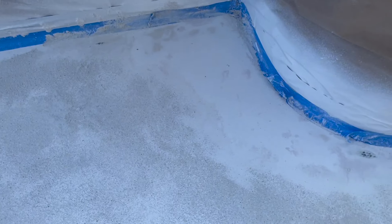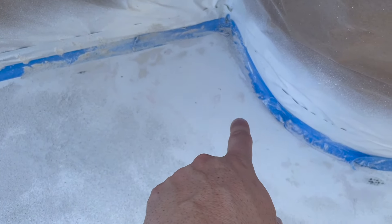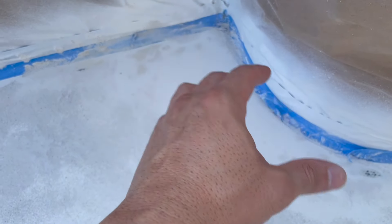I'm going to show you that in a second. Basically what I had to do, or what I tried to do to fix it at the moment, was dab some new gel coat on the areas that didn't have non-skid on them. That ended up being a mess because I picked up sand from all over the place, and it made just a mess of the deck in some spots. So I had to sand everything down. All this area here had just gunk — build up of gel coat and sand — so I had to sand it back down.